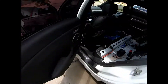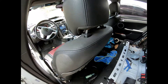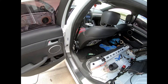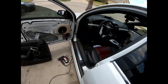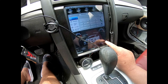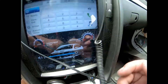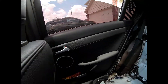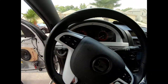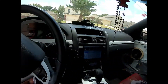All the doors are working — pretty loud. It does have a buzzing sound that's coming from the radio, so I'll get a ground loop isolator from Best Buy and see if that gets rid of the buzzing. We're at volume 21. I'm about to reset the radio because it's not acting right. At 23, all the speakers are working. Almost all the panels are back — I just gotta put the back seats on and trim a bit where the door panel pin goes.